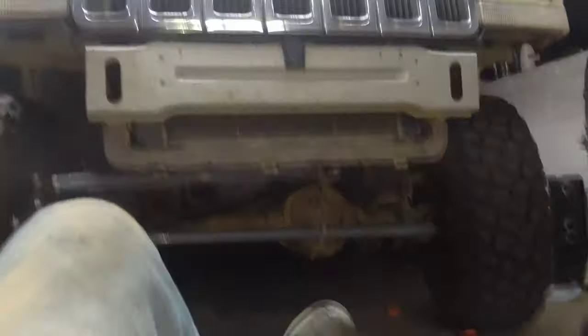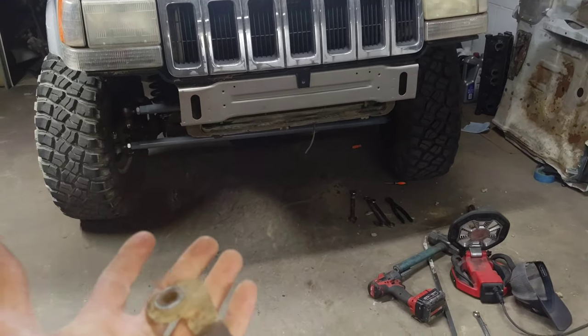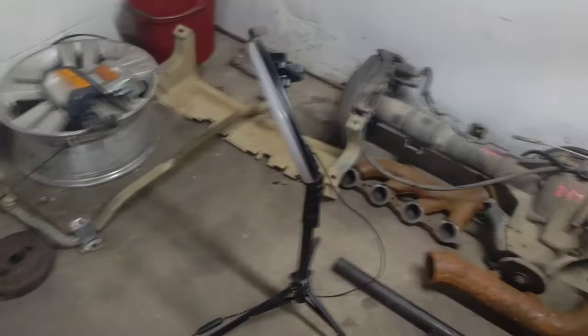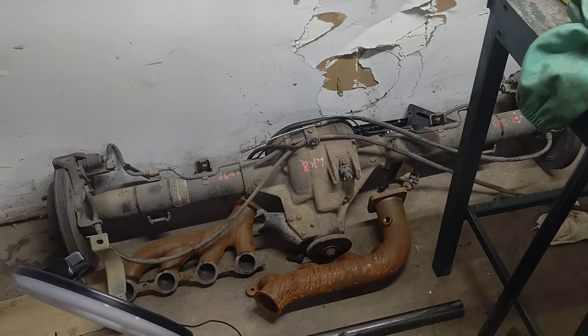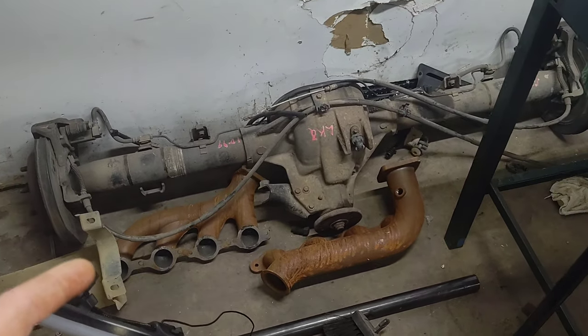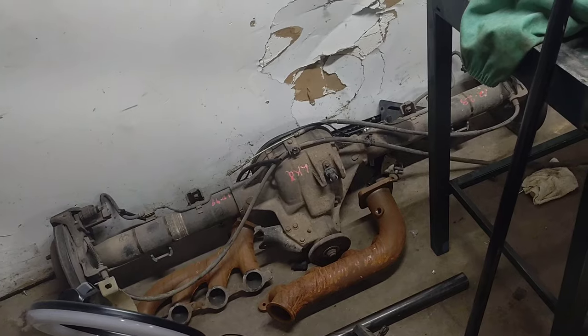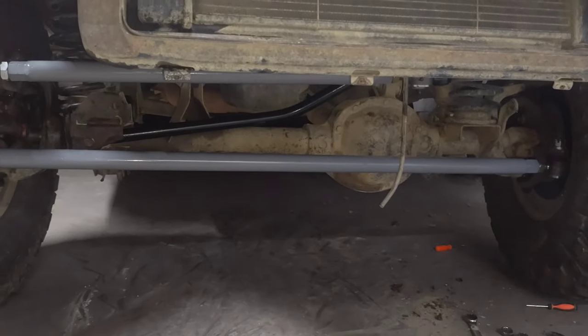That'll finish off all my steering linkage and track bar stuff for the front. I've still got to do a track bar in the back, but I'm going to hold off because I've been looking at how much it'll cost to do long arm stuff. I've got this 8.8 I want to put in with 4.10 gears - I'll have to swap gears in the front too. Iron Rocks has a triangulated four-link kit and I won't need the track bar, so I don't want to invest in one if I go that route. By the time I priced it all out, including time and engineering, I can't do it as cheap as their kit - it'll swap in my axle with the truss, long arms, and subframe. Just the steering setup I built cost 360-something bucks for all the parts, DOM, and shipping.